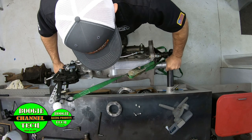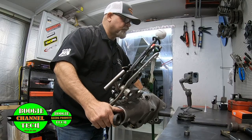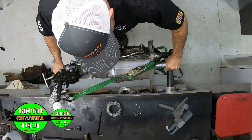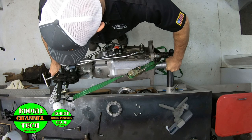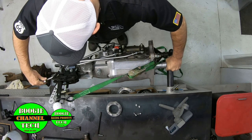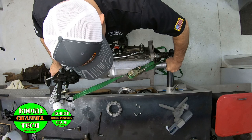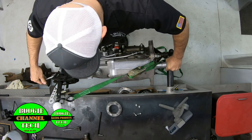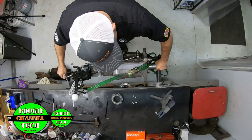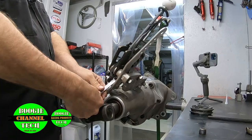I give it another click against the stop — boy, that's hard to turn. You can feel it's got a lot of drag. So I give it a little turn, keep feeling for drag — still hard. Give it a little bit more and now it's starting to free up. You'll feel the difference. You can take the yoke and hold it, take the input shaft, and you'll feel it dragging — it's hard to turn. As you put a little roll to it, the stop is pushing the shifter, moving the slider, opening it up, getting it away from the dog ring. Every time I add a little bit I can feel it — just about there. Now it's good and loose. Right when you feel it's good and loose, you lock it down. That simple.